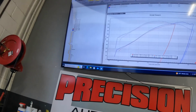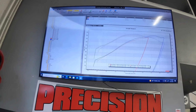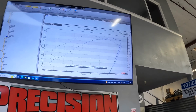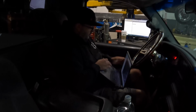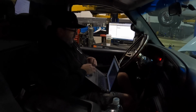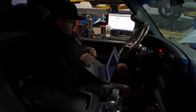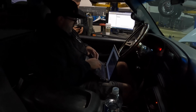That sounds good. What was that? 535, 538 foot-pounds of torque at wastegate pressure. Hurry up, man. Throw some timing in this thing. Throw some timing in there, Jay. Was that the same timing? Yeah, I didn't touch the timing. And you're hitting almost 14 pounds. Almost 14? Yeah, that was 195 kPa. I wonder if it's spiking. No, it wasn't a spike. I mean, the controller's all the way off. Should be 10 pounds.